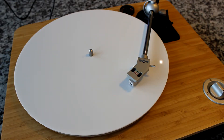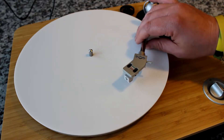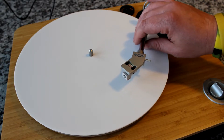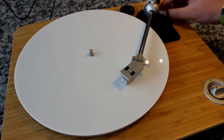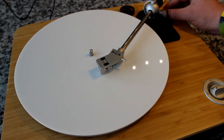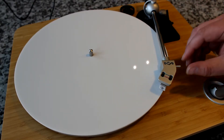It'll wear the record and it won't give you that accurate representation of sound that we want. We want the stylus to be neutral, completely centered in that groove without any bias inside or outside — completely dictated by the position of the groove and the groove pattern. So I'm going to go ahead and turn on the record player and the platter. It is rotating now. You can see that it's set pretty accurately out of the box. If you were to turn this knob to zero, you're going to see it pull towards the center of the spindle — that's the tendency out of the box.